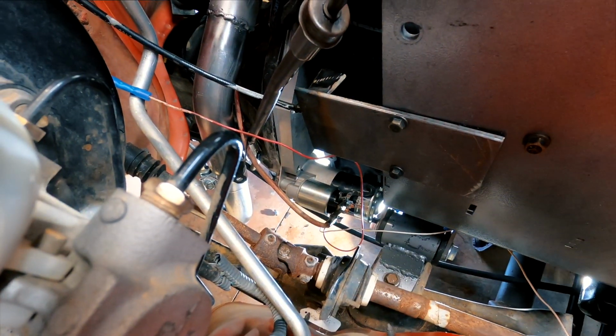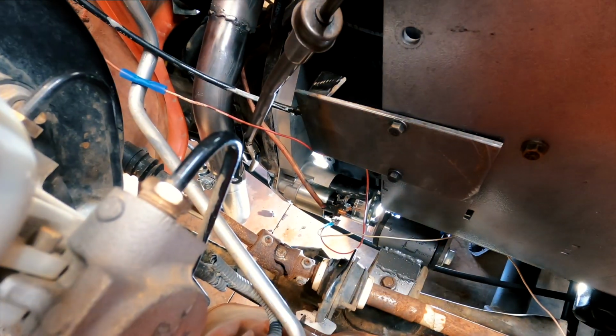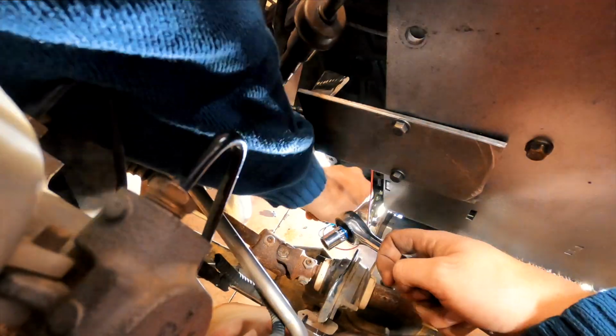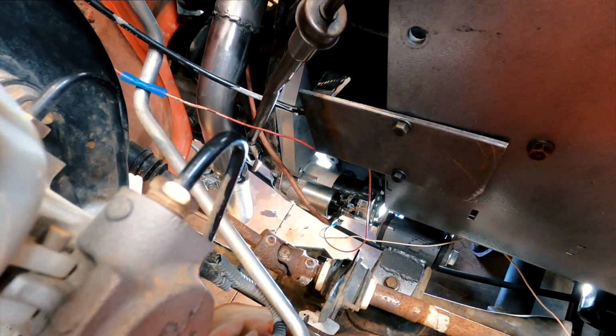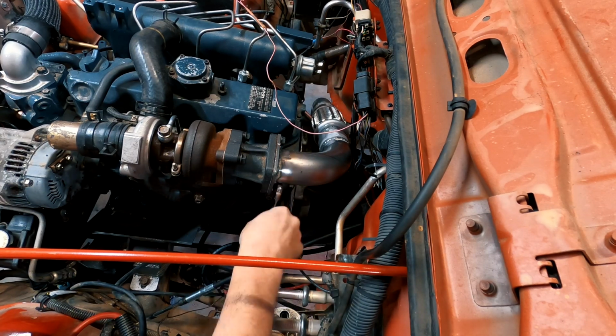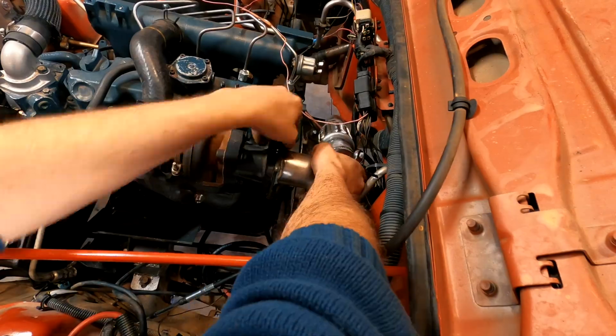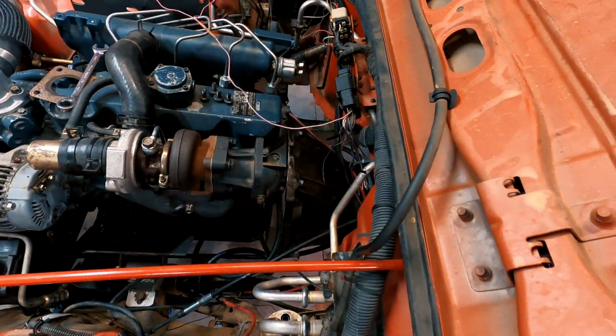With everything looking like it's going to line up perfectly, I quickly realized I still need to reroute the main battery cable to the starter around the dipstick tube for the transmission. And with that done, I take the downpipe off for the final time so I can weld that 90-degree bend onto the 45-degree bend that I had welded earlier.